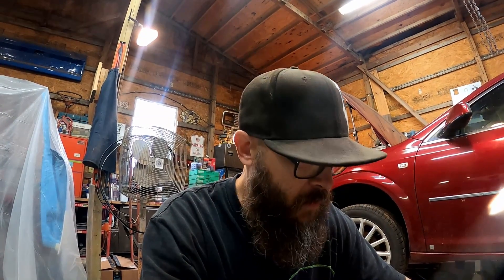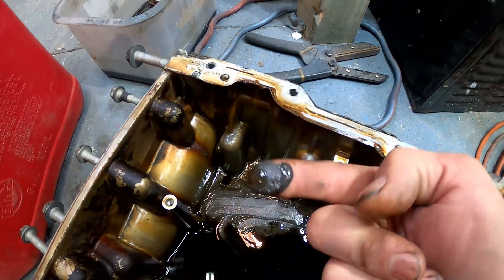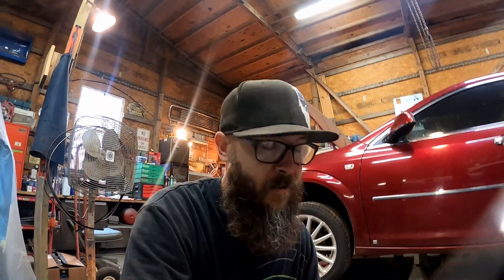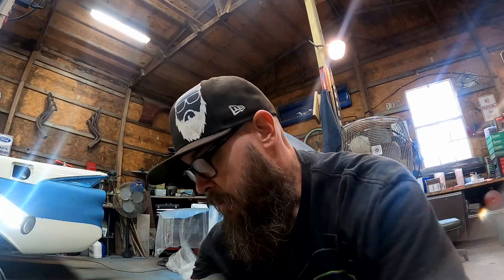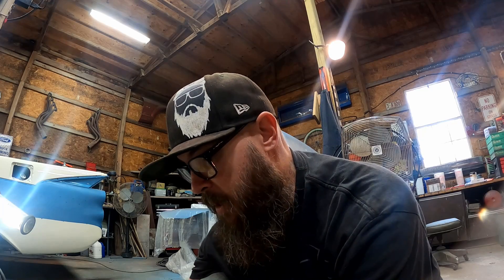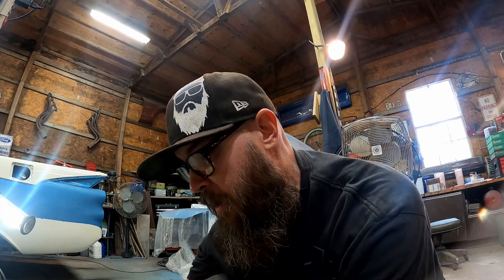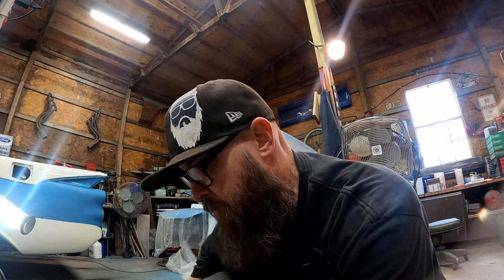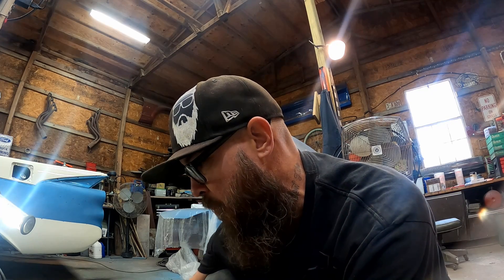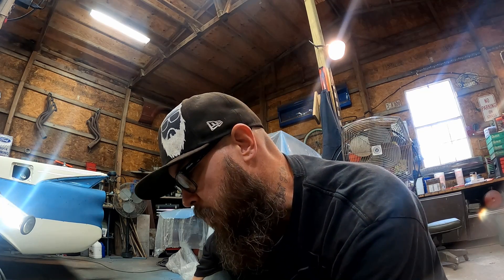I don't know - we may be wasting our time with all of this because all of that metal debris has been sucked through the motor. You could clog up those VVT solenoids and you're in for a world of hurt. All that crap has probably been sucked up into those things, so we may have to end up replacing them. We're going to give it our best shot and see if we can get the old girl running. With it being ran low on oil enough to tear up those bearings, who knows what it's done to those timing chains on these 3.6s.